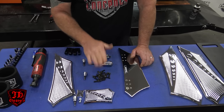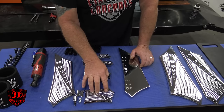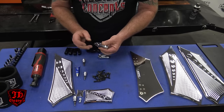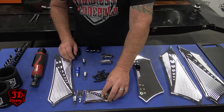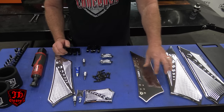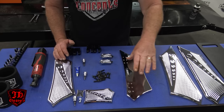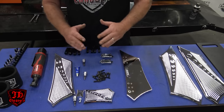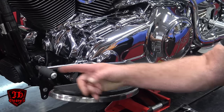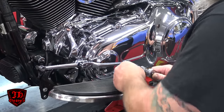The bolts for the shifter pegs are going to be a quarter inch. The bolts for the pads that go on the bottom of the floorboards are going to be three-sixteenths. The two bolts for the brake pad itself are going to be five-thirty-seconds — so you will need access to those three tools. When we put these shifter pegs on we are going to be leaving those on, so we'll add a little blue Loctite to those and the brake pad as well. I would also add blue Loctite to the bolts that go in the bottom of the floorboard, but right now we're still trying to decide which ones we want to run — the short or the long. So for right now I'm only going to install these without the blue Loctite until we decide.